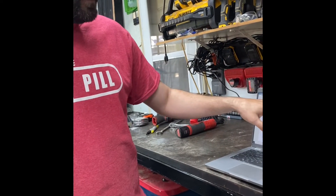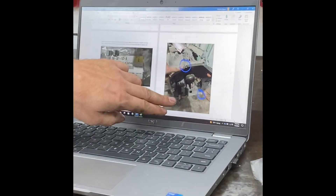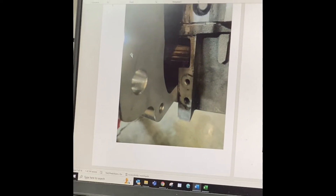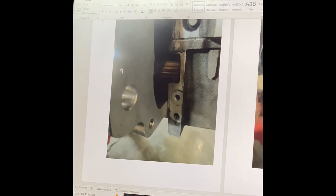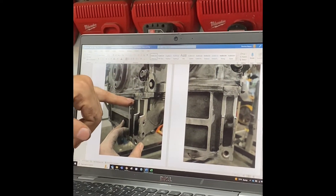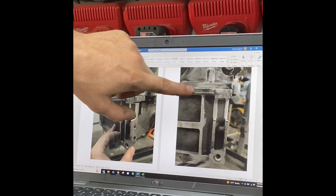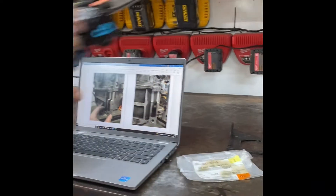The first step is actually grinding out the oil pan. Because the Audi is an all-wheel drive transaxle, it has a front wheel drive shaft coming out the front at the bottom. You need to grind this lip out of the oil pan to clearance that shaft. Some guys like HCF will delete that for you. A lot of people like Fran at RCR do not recommend doing that — you can do your own research, but I decided to leave it in. You're going to have to grind this lip out — there are two little lips at the back of the pan. Starting at the flat at the top, you'll cut out one and one-quarter inches. They recommend using a Dremel, but in my opinion that would look like crap — use a file sander instead; it makes it look nice and clean.